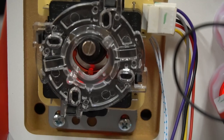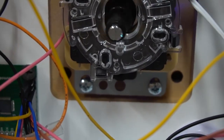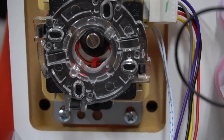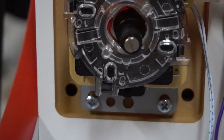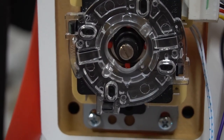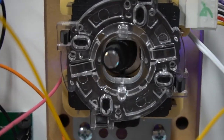You see the diamond, so up, down. I'm not hitting that corner, whereas this one, player two, is set up 8-way. See that? I'm not really a fan of this because, in all honesty, oh no, it does let go. If you listen carefully, it is actually letting go of that. This right now is a 4-way joystick. See that? 1, 2, 3, 4. So I can't do 9 o'clock or 2 o'clock. If I was playing Street Fighter, I could only go up, down, left, right. I would never be able to flip forward, whereas this again is an 8-way joystick.